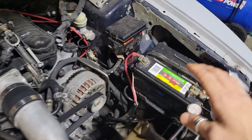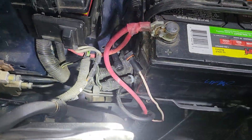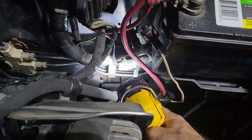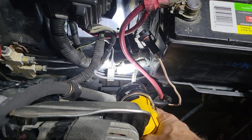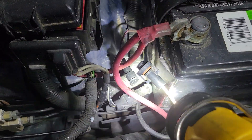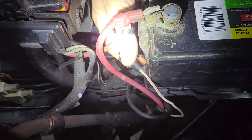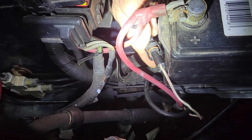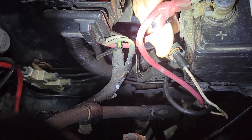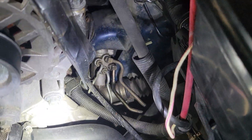On this side of your battery you have two different wiring harness connectors. The lower one is going to be a CCRM power and ground — if you pull it, it will pull power from your CCRM. The other one is your signal switch power, and then the one that's already disconnected is going to be your solenoid switch from your starter. It's always going to have this hard pinch in the center.